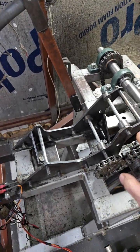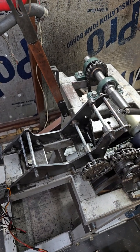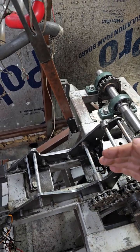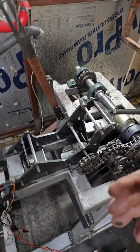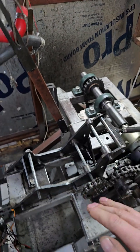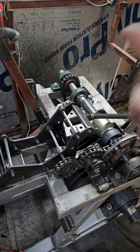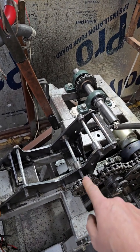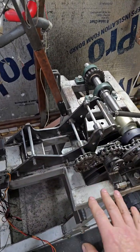So one thing that's a big drawback with this setup is the fact that if you have a poorly tuned engine where the porting doesn't work with the pipe or the carburetor's not working right, the motor will tend to lunge. And you can see this on bikes that are on wheel dynos. But the thing about a bike on a wheel dyno is the bike has its rear suspension, so it can do some squatting, and the bike can move forward a bit because of the stretch of the straps, and you have the rubber tire that takes up a lot of the shock. If it lunges on this style, it's going to break a transmission if it lunges hard enough, and I've had that happen. Like I said, if the tuning isn't right, you can run into problems.